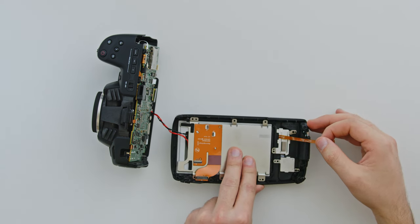Next is the display. Take the display enclosure from the mod kit box and the scalpel knife. Use this to lift the edges of the protective paper to expose the adhesive for the screen. Peel the protective paper, leaving the adhesive strips. Now take the LCD screen from your camera and the display back panel from the mod kit box — we're just going to use this to prop the LCD screen up to make the screen install easier. Make sure that the larger border on the display is on the left-hand side. With the hinge gap at the bottom of the display enclosure, carefully align the screen's borders with the inside of the enclosure — there should be an equal gap on all sides. Once the screen has made contact with the adhesive, you should not attempt to remove it, so take your time and make sure it's aligned perfectly before dropping the enclosure down onto the screen.